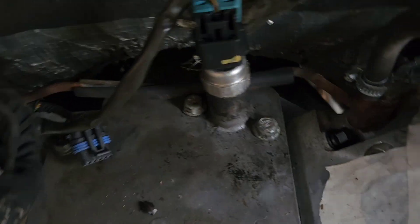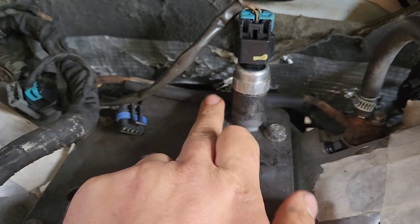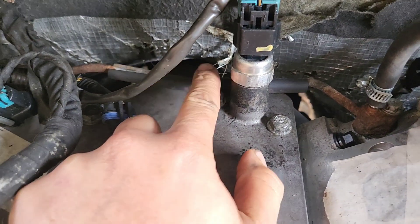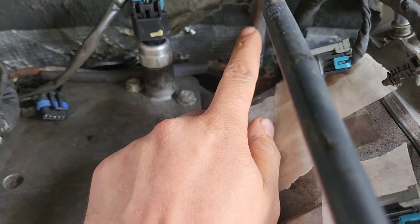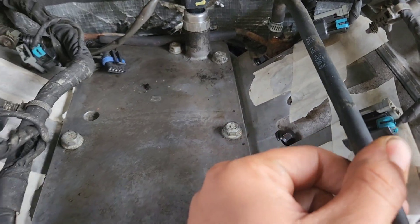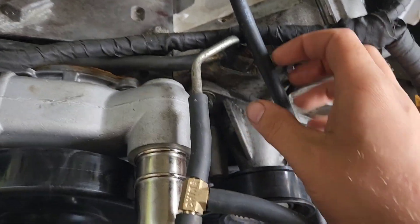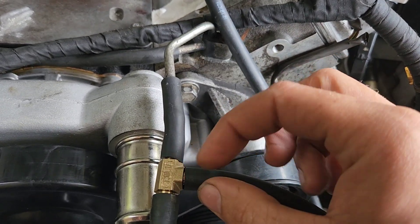Here's a little mock-up of my DIY four-corner steam kit. This steam kit is off of a '07 Escalade L92, and I got it bent just a little bit to where it clears the oil pressure sensor. It's got a rubber boot over it — that's factory — just so it doesn't rub a hole. I've got a three-eighths hose, or five-sixteenths I think, and you're gonna bend it so it barely goes over the intake manifold along the fuel rail. I'm gonna have to shorten this a bit.